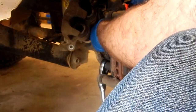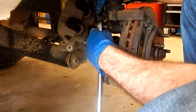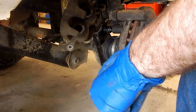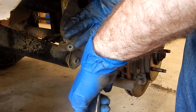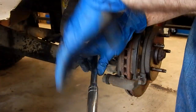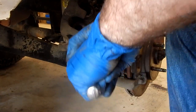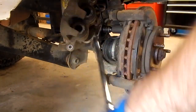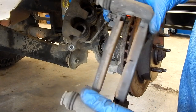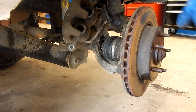We have to move our ABS signal wire out of the way. We need an extension. The wheel turned just a little bit — it can make it easier if you don't have a big ratchet and you've got to use a breaker bar. Sometimes with breaker bars, especially if you're working on a car, you can't get enough movement underneath. So turn the wheel that way you can have the breaker bar coming out. We can take these off with pads already in — that way we can just set this aside. We know which pad goes where, they're already in the sliders. We will grease the slider pins on those.